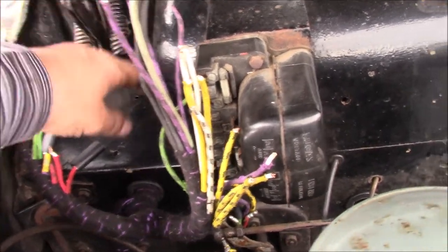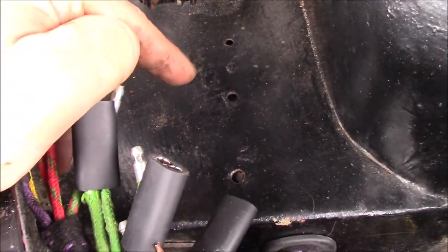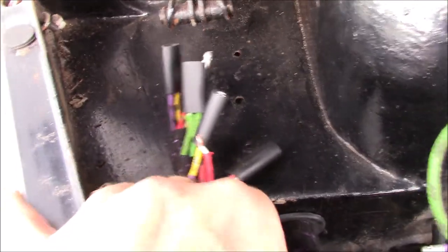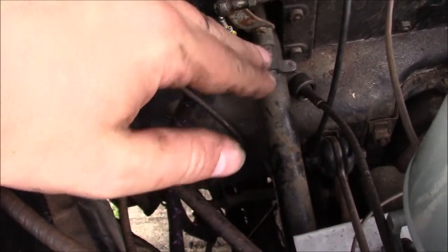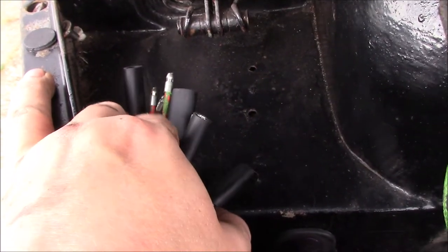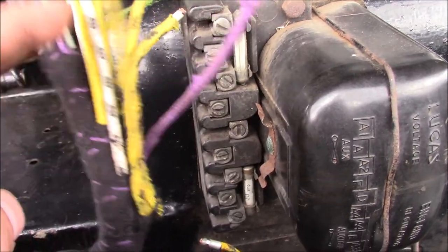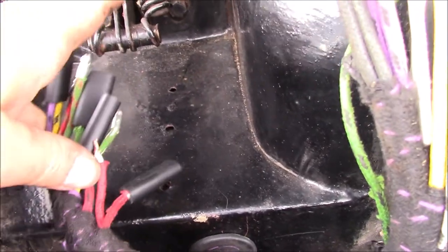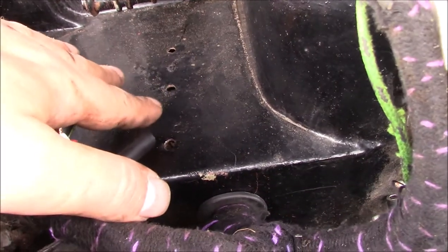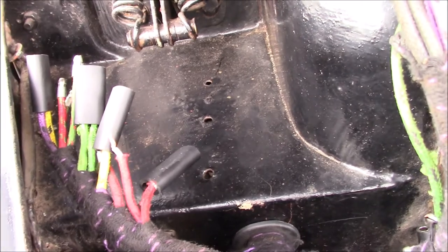What I didn't know was this area up here on ours. You can see there's some little holes and I think these are for cable clamps, because it looked like this area here where you've got all the connectors joins onto the section that goes from the steering column. There's a section that runs on the outside of the steering column. I think this area used to have a different kind of connector block - very similar to these sort of terminals. I've seen them for sale before for cars of this era, and I think originally there was a connector block on here and these were bare wires and you just screwed in whichever ones you wanted, a bit like a really fancy choc block. I think that's what's been causing me the confusion - we're missing this piece completely and the way it had been rewired was also very different to any other car I'd seen. So I think we've got to the bottom of that.